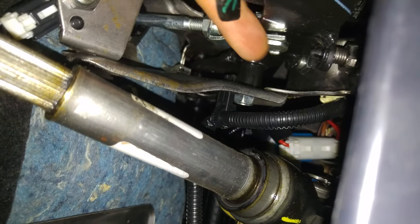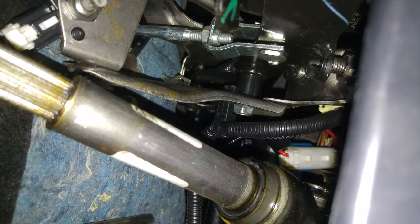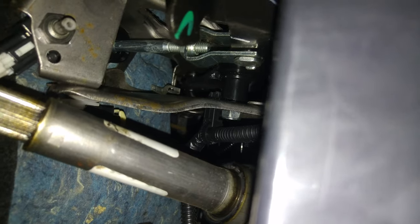So we know that that is the source of the noise. Hopefully WD-40 will be enough to lubricate that and stop it from coming back, but if it does come back then I'll try a different lubricant. The other places you could try would be up here where the pivot point is on the pedal - there'd be some plastic bearings there - or you could try under the bonnet where it comes through and onto the clutch, but it sounded like it was coming from inside the car.